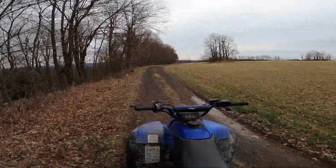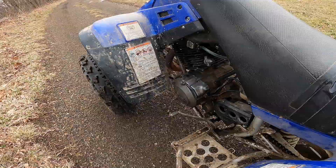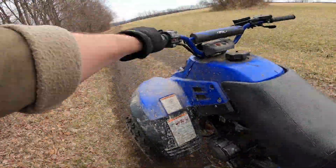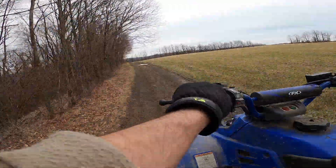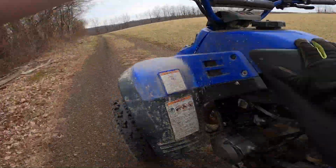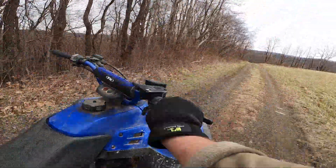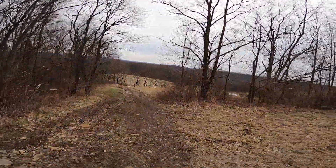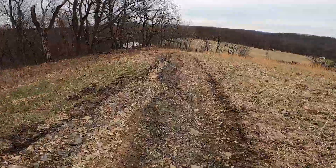That's where the Warrior is at — I thought we had it, but apparently there's still something going on. I did tow it back up to the house and it did start back up. I've since adjusted the clutch, thinking that maybe it was getting hung up and causing it to stall. It is running now, however it won't idle — I have to stay on the gas to keep it running. Still ripping at full throttle, but if I let off the gas it stalls. I'm thinking I have a pilot jet issue, because once I get over a quarter throttle the thing takes off — it just won't run well below a quarter throttle.